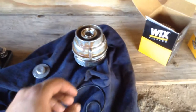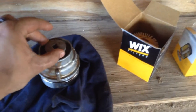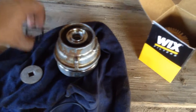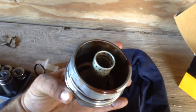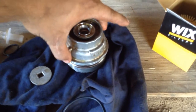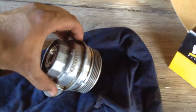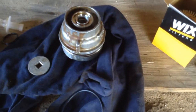Let me show you what the oil filter is like. You start off with this plug piece in here — what you do is take this piece out and then insert this plastic piece onto here, which drains the filter housing. This usually comes off with that plug and you'll have to replace it, then the whole housing comes off — that's where the oil filter actually goes. So you take this out, press this in, it all drains out through that tube. Then you take the cover off using a punch on the side to twist it off. We just need to replace these O-rings and reinsert.